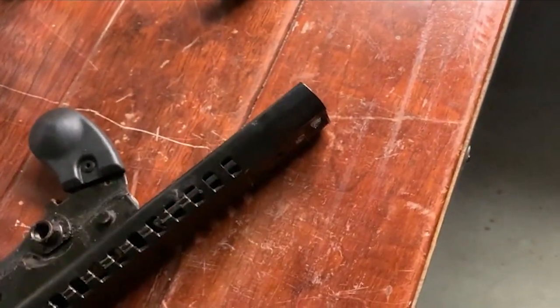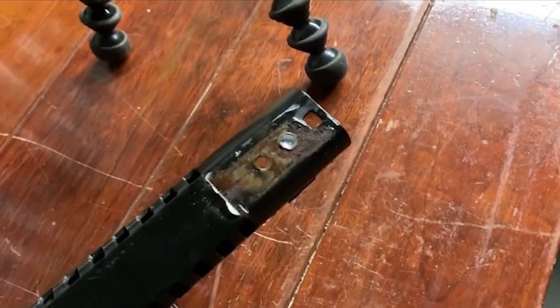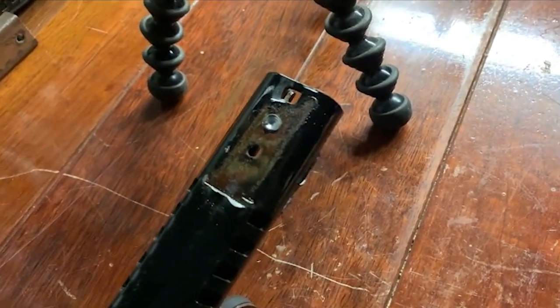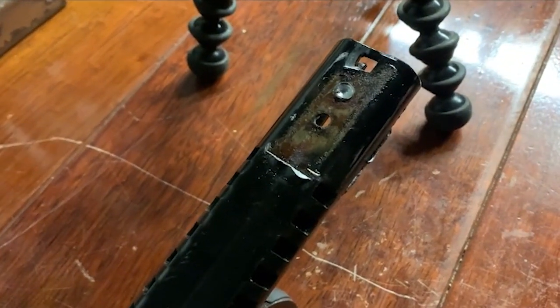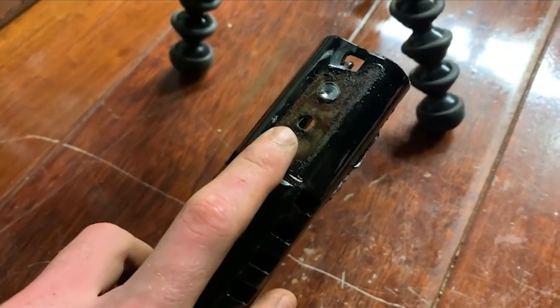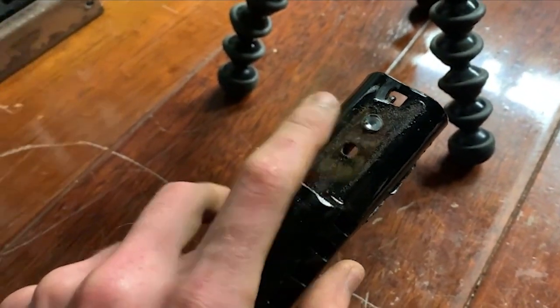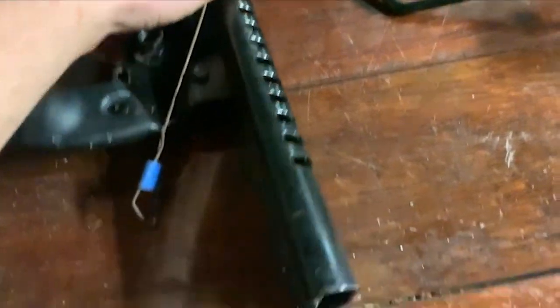And so, new method basically, I'm copying what the OEM manufacturers did. Only difference is I'm using a higher tensile nut and bolt instead of the weird little nut and bolt they had. Plus, I'll be doing a spot weld again. And as for these ones, they had